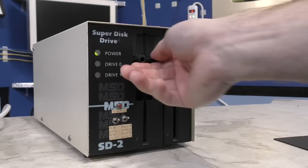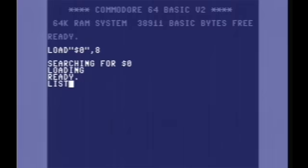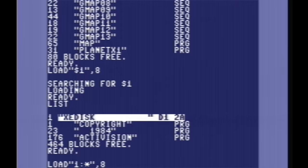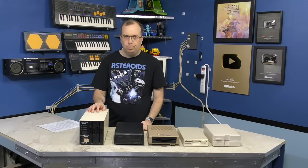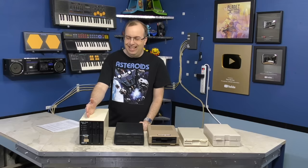It shares something in common with the PET drives in how it handles having two drives on the system. To demonstrate this, I'll insert Planet X2 into drive 0, and then Ghostbusters into drive 1. To get a directory from drive 0, you simply add a 0 after the dollar sign. Drive 0 will fire up, and there's the directory for Planet X2. And then to get the directory of drive 1, you just type this, and drive 1 will fire up, and there's your directory. To actually access a specific file, you must place a 0 or a 1, followed by a colon, and then the file name — or in this case I'm using an asterisk to represent the first file on the disk. The problem with this is some software will have to load in additional files afterwards. If no drive number is specified, the drive will usually assume drive 0, so some software will fail to load correctly from drive 1. The MSD drives were very popular with BBS operators because they could store essentially twice the amount of data as a single 1541 disk drive. They were also very popular at copy parties because they were designed to copy from one drive to the other very quickly and accurately.